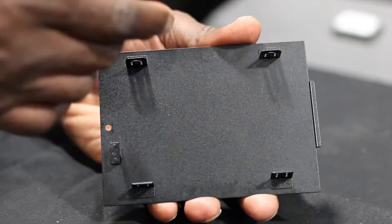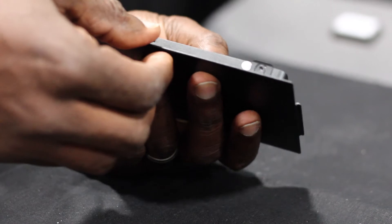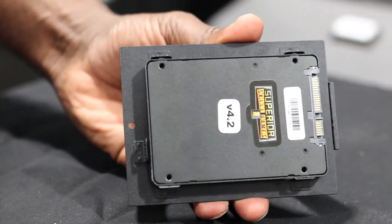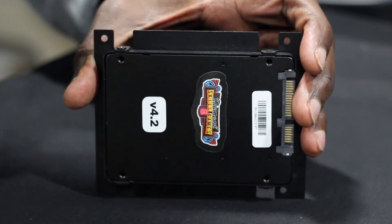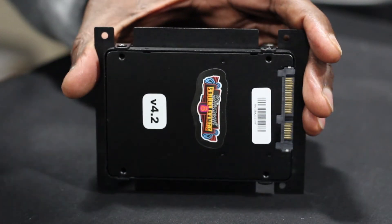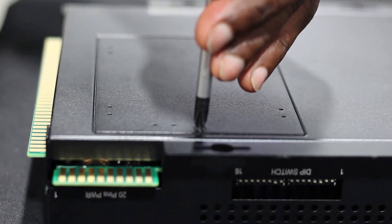If you're using the single screw drive panel, make sure the connector contacts are facing the lipped edge of the panel. If your hard drive was connected to the drive panel by screws, replace them to continue. Reattach the drive panel to your board device by replacing each screw removed earlier.